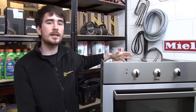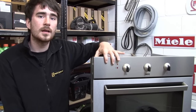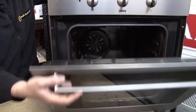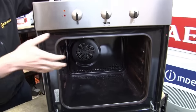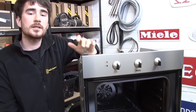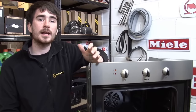The thermostat is situated at the back of the cooker, so if you've got a built-in one like this one, then you'll need to remove it from its cavity. You can do this by removing the fitting screws, then lifting the oven out of its cavity and unplugging the cables. Once you've got the oven into an open space with enough room to work on it, you can get started.